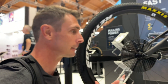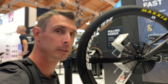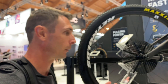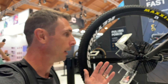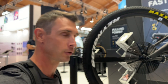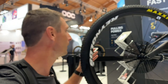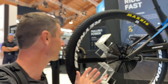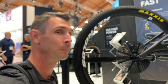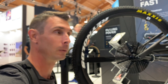But why do all this? It seems like a lot of changes. Two reasons: efficiency and aerodynamic gain. They just published an aerodynamic test in the Specialized wind tunnel showing this is massively more aerodynamic than a normal cassette and chain cluster. Efficiency-wise, when they introduced this last year, the numbers they were throwing out were: a brand new Dura-Ace drivetrain fresh out of the box is about 97% efficient. With their ceramic or wax-coated chain, pulleys, and everything fully optimized, you're looking at about 98%. With this driven system, you end up over 99%.